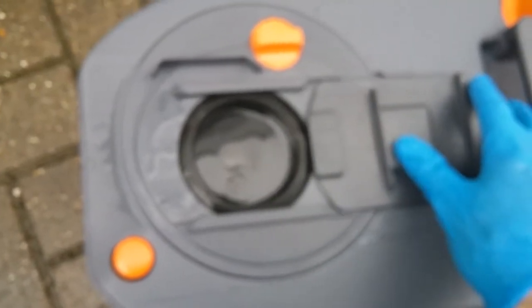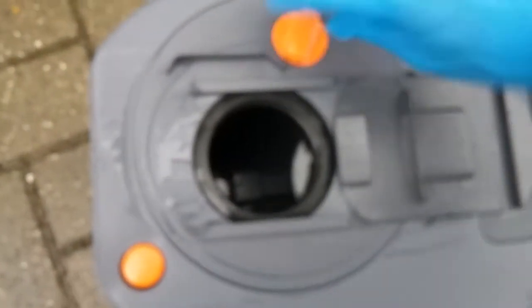It's also advisable to keep this seal lubricated. Thetford do their own seal lubricant, but any silicone based lubricant is fine. This is also a nice, quick, handy way of giving the cassette a good clean.